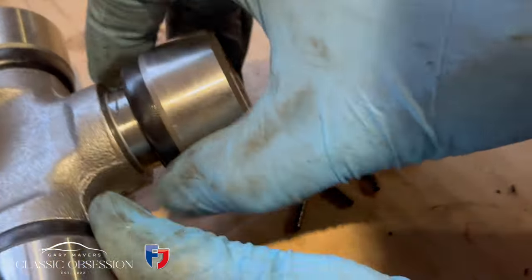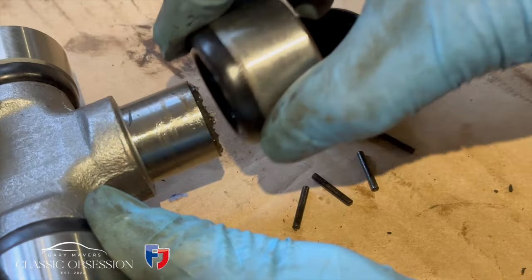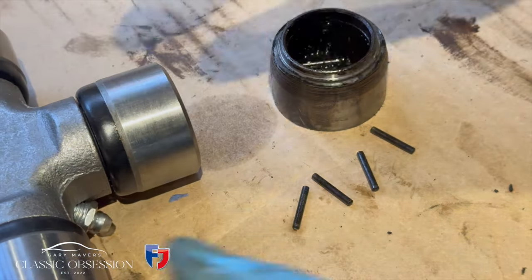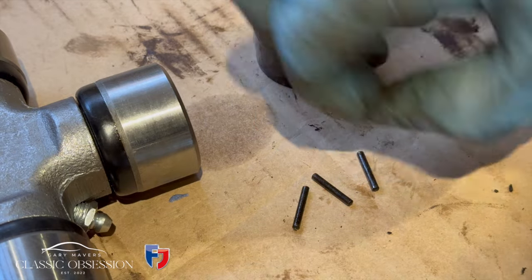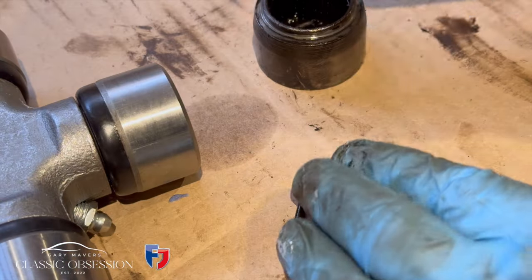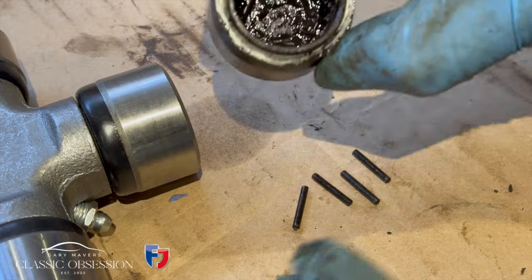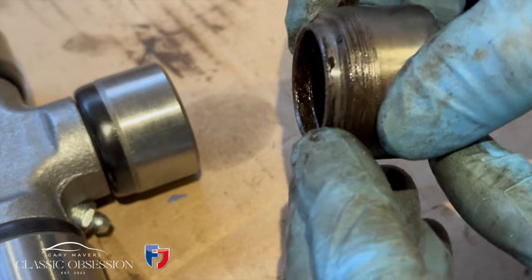Now inside here — see all them little needles — these are filled with grease through your nipple here and they act like a kind of bearing. This is the old one, look how dirty and filthy that is, and these are like the little needles, tiny little needles that just go all the way around. So you've got to be very careful if you're tapping these on when fitting them to the short axle — just be careful that they all stay in situ, because if they come away you'll never compress your end cap and you're into all kinds of problems.